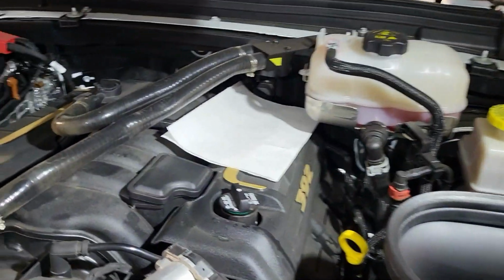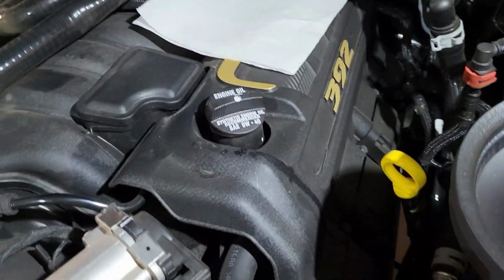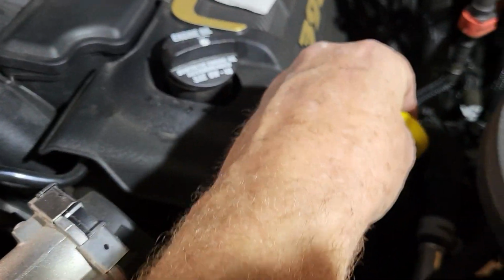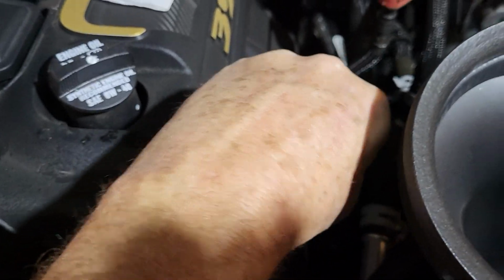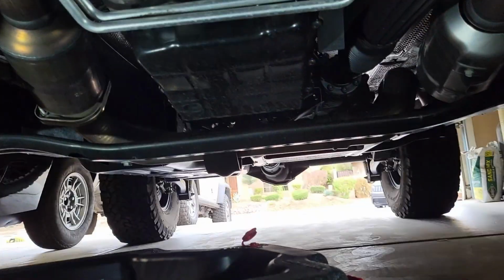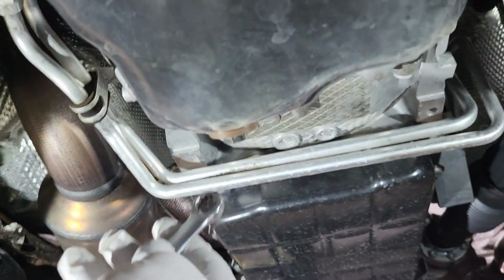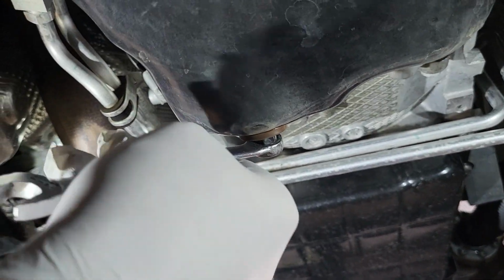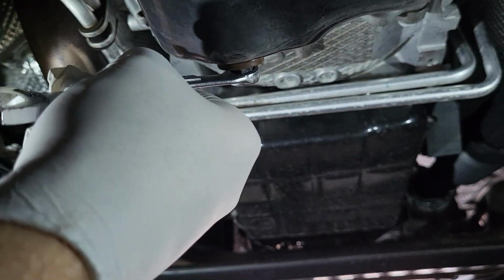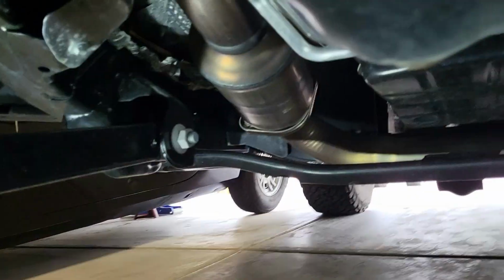So let's get on. First thing to do is drain the old oil. Crack the cap here and put it aside so dust doesn't get in, and possibly pull the dipstick up a little bit to allow air in, but not to allow much dust in. All right, using nitrile gloves on your hands and getting yourself underneath the car. I like to come on the front of the oil pan so there doesn't splash any oil on you. Get your 13mm wrench on that and turn it counterclockwise to release it. And now placing your catch can under, with a splash arc looking like it'll hit it.